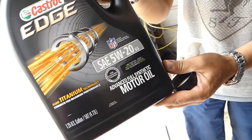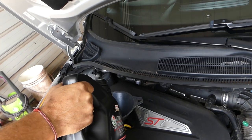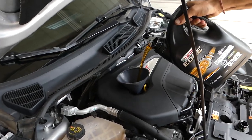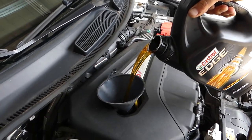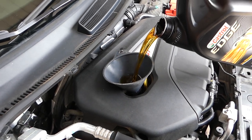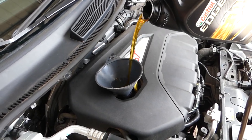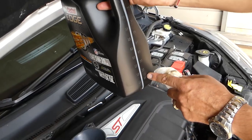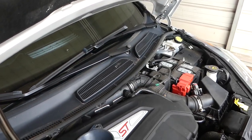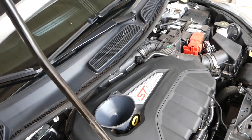Make sure you add enough but don't overfill it. If you overfill, it could seriously damage your engine and catalytic converters because the oil will try to burn and fog up the cats. We have about 0.9 liters left to add, so that should be good.